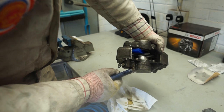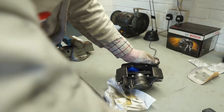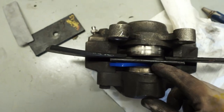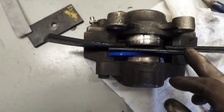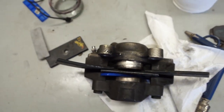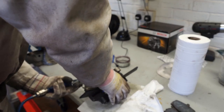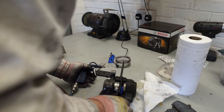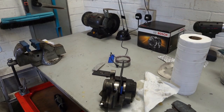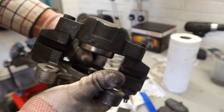That's made a bit of a mess but it looks like it's going to move most of the way out — a good illustration there as to why we want to keep our eye protection on. I've now moved the metal configuration to try to keep the non-stuck piston in place and get the stuck one out as far as we can. The stiff one has come free — and it looks as though this rubber seal has got damaged or somehow managed to get out of its slot.